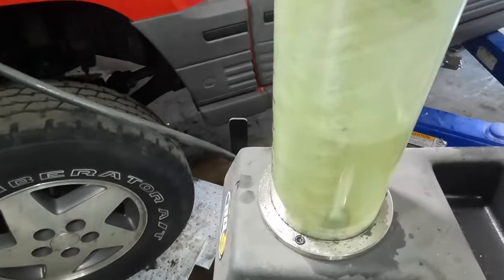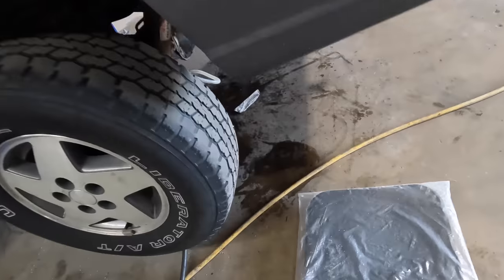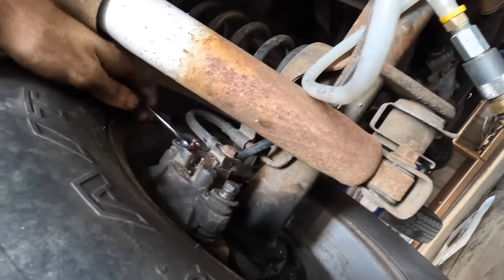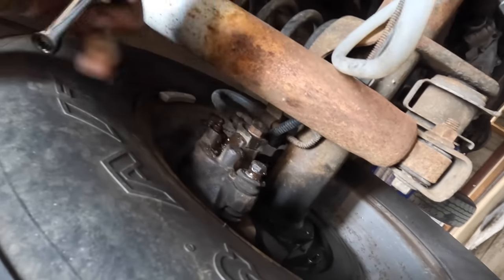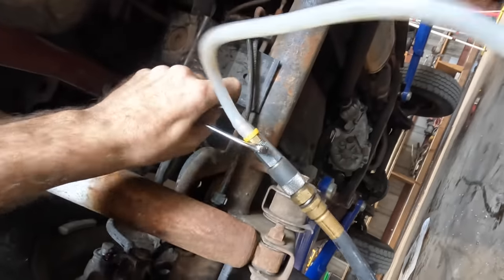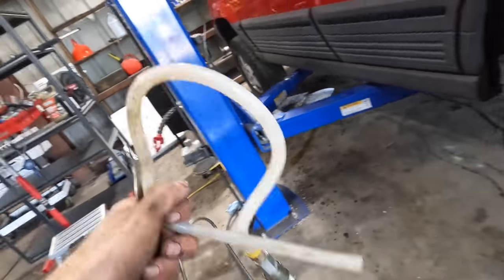The spillage on the floor is from me — the master cylinder overflowed. Still going, a little less than halfway. Reservoir is nearly empty so let's close this off, let it suck out the remaining fluid, and check for air. Negative — no air. I know you might wonder how there can be air when you're running fluid through, but there could still be air in the system, and I want to make sure.